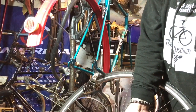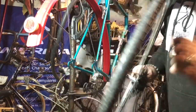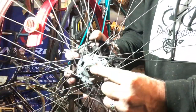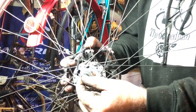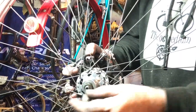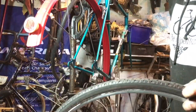There is a set distance by which the axle should protrude. You can see it's already set up on the non-drive side — basically it's the width of the frame material so that when you tighten the quick release down it has something to bear on. I need to space out this side now that I'm happy it's going to fit in there properly.